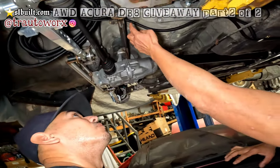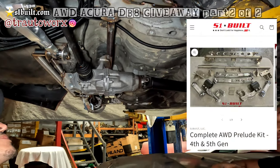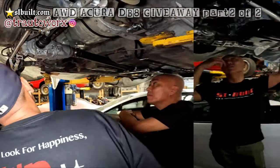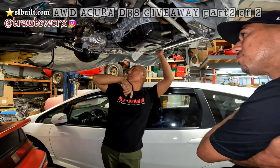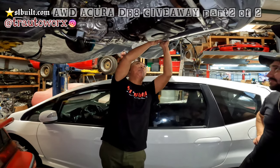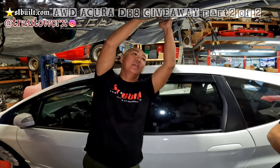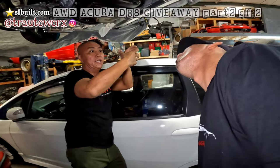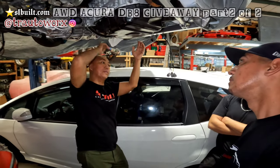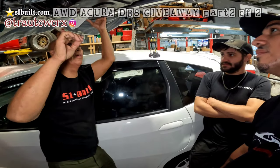This one here, it bolted up, but then we welded it. This is just for reference, you know. It came out good. Mike and them started to put the harness together and all that. But we're like, well, we can't really do that much because even the manifold, we had to swap Ricardo for this style here, the centipede, instead of the other one. Right. Oh, because it's easier to do the piping to go this way here. So he was looking for one and we were looking for this style here, and it worked out perfect.